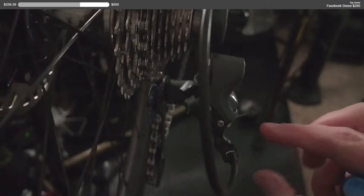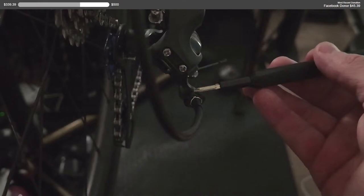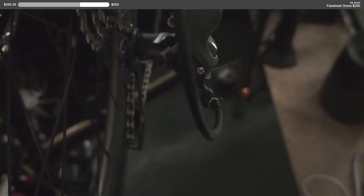If you hear an unusual amount of noise coming out of the back, that's where you'd want to, if you're out on the course, maybe just do one or two corrections here, or if it's nothing serious. My rule is, if I have to move this adjuster more than 3 total rotations in any direction, we get a reindex.